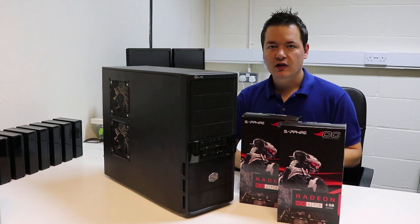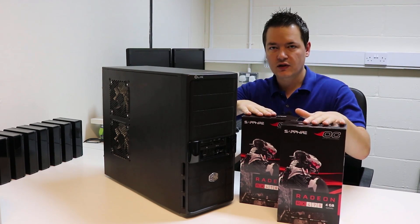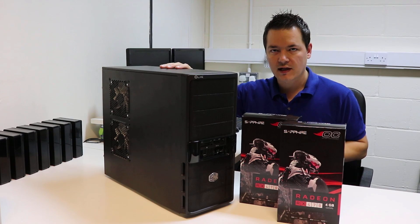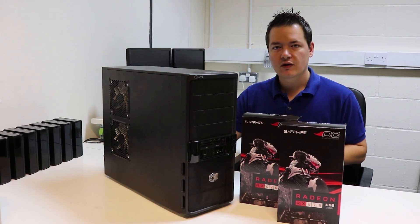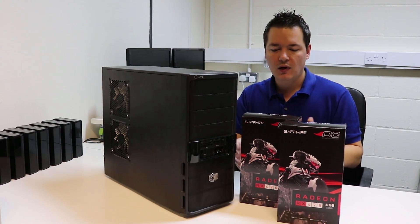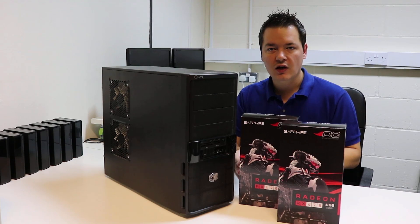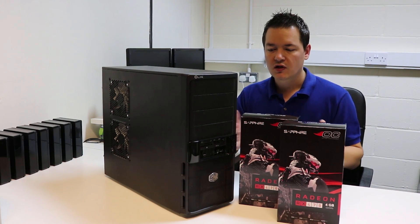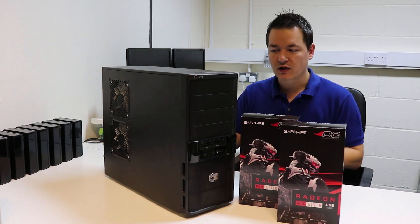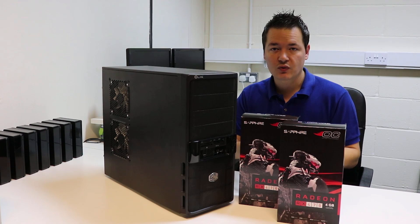So what I was looking to do with these two RX 470s was to put these two into here and then sell out this old hardware — the 280X and the 7950 — sell those, retrieve some money back and replace them with new, updated, more efficient hardware. Each one of these GPUs should use between 100 and 120 watts, so I'm kind of expecting to reduce my power usage on this machine by about half — going from about 450 down to about 200 to 220.